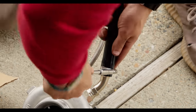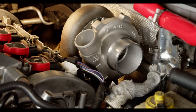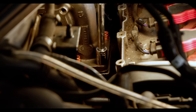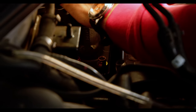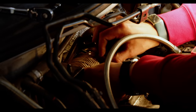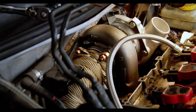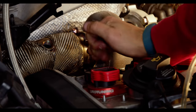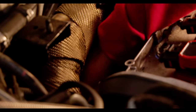The turbo is not going in alone — we have to include both the coolant drain and the oil drain because they're on the back, and once the turbo's in the car we have absolutely no way to reach back and tighten them without taking the turbo off. From there, we get to wiggle the O2 pipe into place. It's a pretty tight fit, but once it's lined up with the turbo and the gasket's in place, you're good to torque it down. Or at least, so I thought. There's a lot of flexibility in the fitment of this kit, and final assembly was where I really learned that.